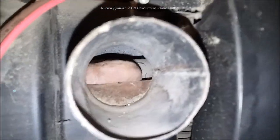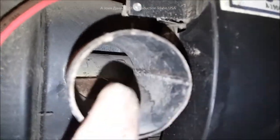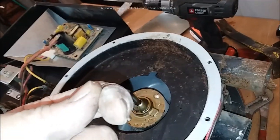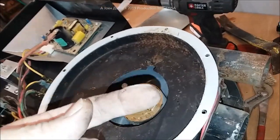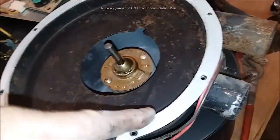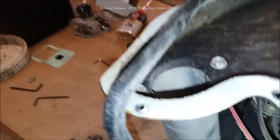The air intake will usually get wasps in it and everything else. These little gaskets on here — you can use nothing but a standard exhaust-grade RTV sealant — just put a thin film on here and replace it. You don't have to buy the expensive $15 gasket. This here is just a row of screws; your gas pipe supply is right here and you'll just work that cover off.